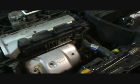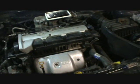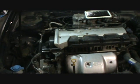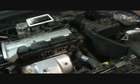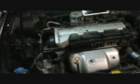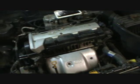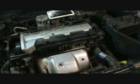These are spec'd to be replaced at 60,000 miles. This vehicle currently has 143,000 miles on it and no records of timing belt service to know when the last one was done. The timing belt still looks good, I have the cover off here, but you don't need to push that because this is an interference engine, and if the timing belt breaks teeth off of it or breaks completely, you'll have to pull the head off to fix it because you'll have bent valves, and that's just a nightmare. You just don't want to risk that.